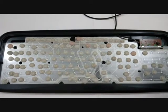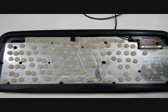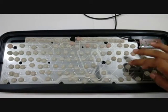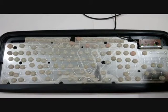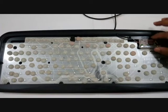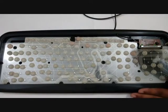If I put back the keyboard cover and use it, some of the keys on the numpad — 7, 4, 5, 6, 8, 9 — won't be pushed back because some rubbers have gone missing. The transparent plastic layer is the most important part of the keyboard; it detects the keys when you press them. There are also three separate layers of plastic that work to detect the keys. Two of them are covered in electrically conducting metal tracks, and there is an insulating layer between them with holes in it. This area also contains the circuitry for the num lock and caps lock.